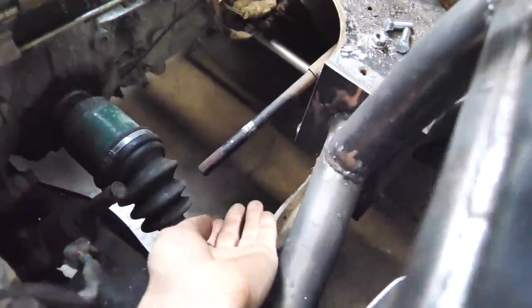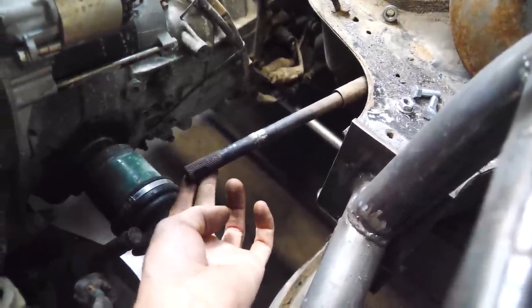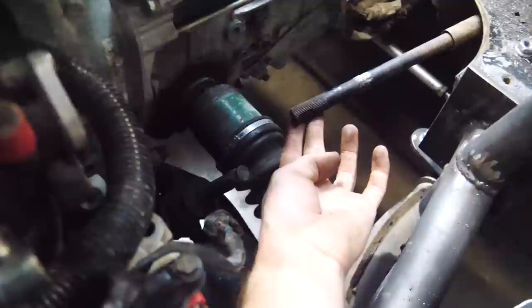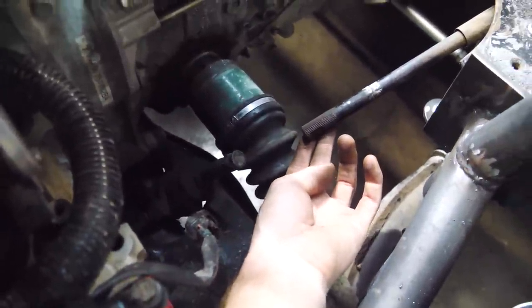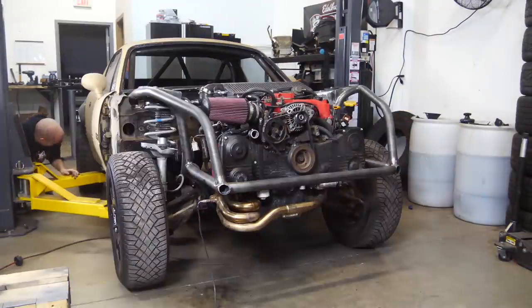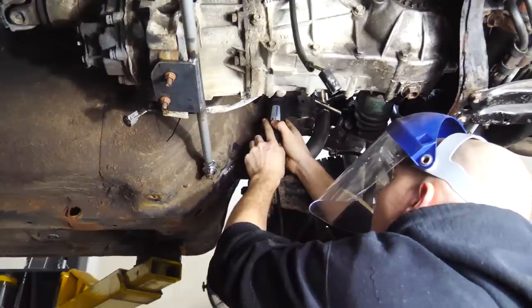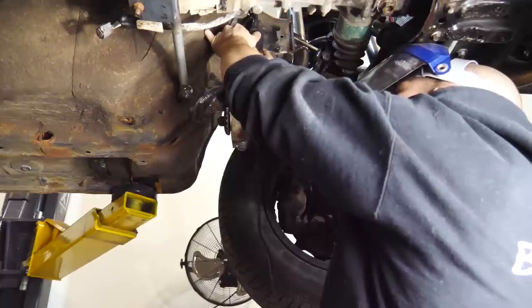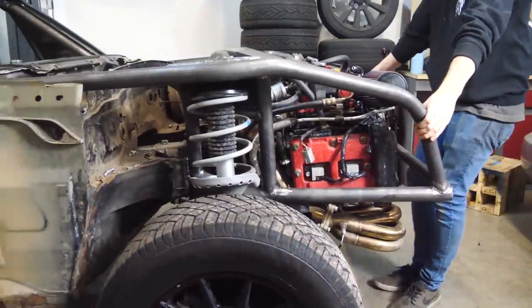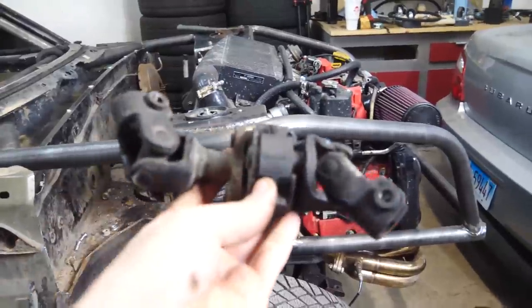After cutting out the firewall a little bit, it can come all the way up to here, which, at the max height, is high enough, right? It just has to come over a little bit, because you can tell it doesn't quite line up. If it's lining up, then it's too low, so I'll cut a little bit more, and then it's looking like this is gonna be pretty easy. Looks like I cut enough of the firewall for that to line up. Now we have to cut this.